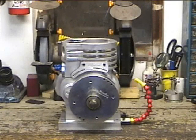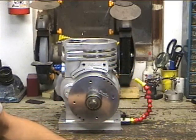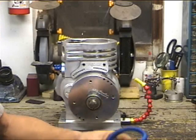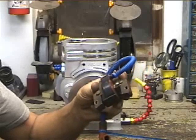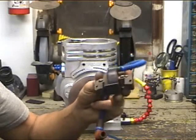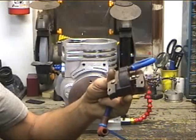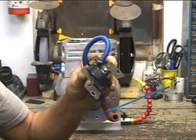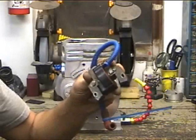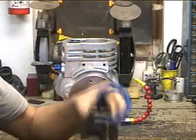Hopefully I won't get in the way and block the camera too much. What I'm going to be using is a 3 horsepower coil — that's just what my motors are set up for. The one thing you'll notice about the 3 horsepower flywheel coil is there is no real reference as to where the pickup coil or pickup spot is for the timing mark. I'll show you what we used to reference and where I got the information. I'll also put up a picture of where you would use the reference point if you were using a 5 horsepower coil that does have that round little metal ignition coil pickup point, and where you'd want to put that pickup in relationship to the magnet when setting the timing.